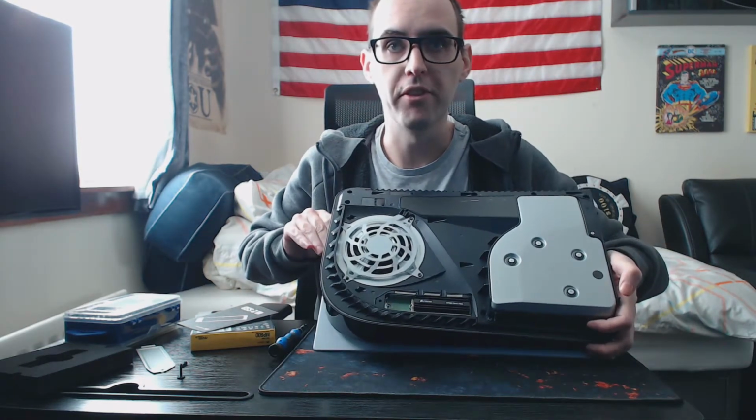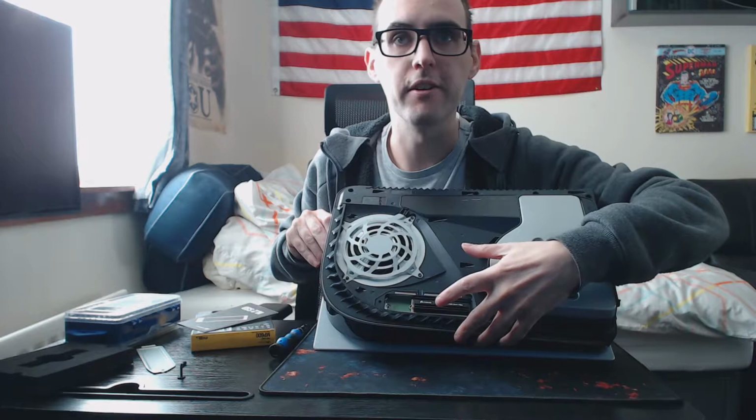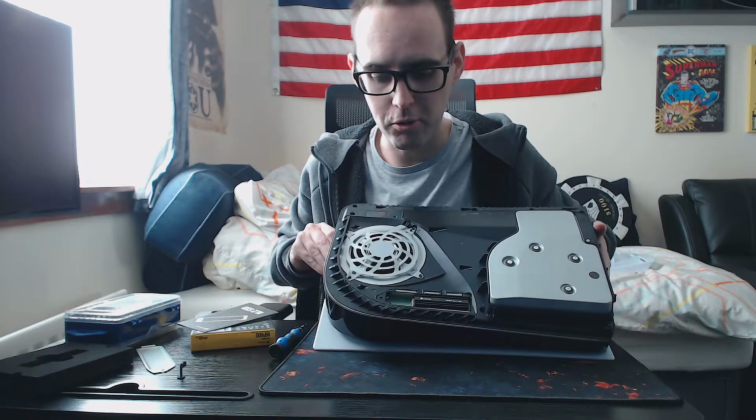As you can see, it does actually line up with the 80mm marking there, and it'll lift up. That's why we're going to pop the screw back in there, and I don't think we're going to get that closed, to be honest with you. Most NVMe SSDs will be 80s. We take our little screw that we took out of that little ring, not the PlayStation logo screw. That is the difference between them. One has the PlayStation logo on it and one does not. We just pop it back into the little ring that we took out, and we will just screw it down simply like this.